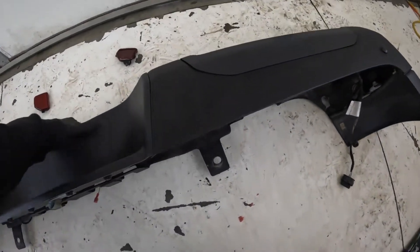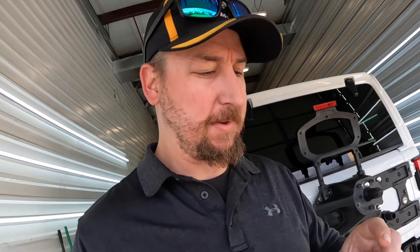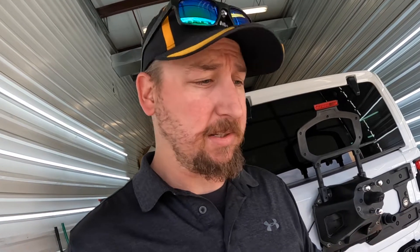Looks like I've got to order another set of these before we can get this project completed. I got a new set of the Oracle reverse lights — just using the driver's side since the passenger side was fine, so I've got an extra passenger side. On this one I already went through and shaved down a bunch of areas using a Dremel tool so that I can get it to fit in there properly. I'll test fit it, cover the lens, get a little black paint on there to make it nice, then get the bumper put back on the Jeep.